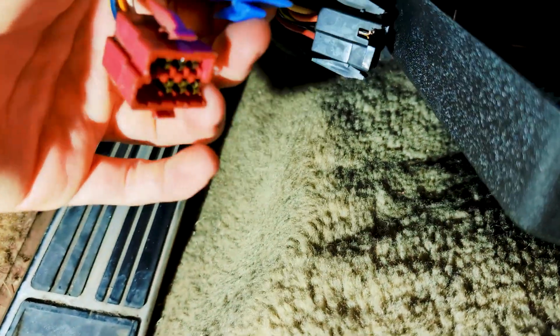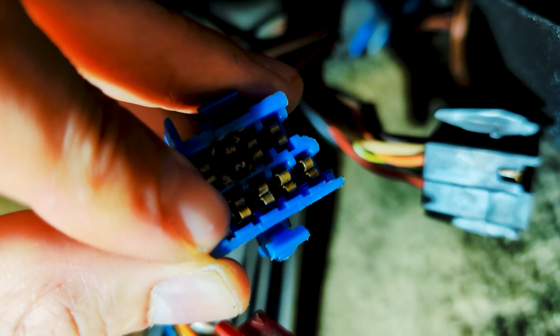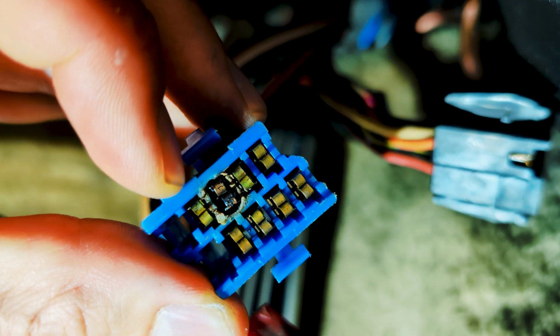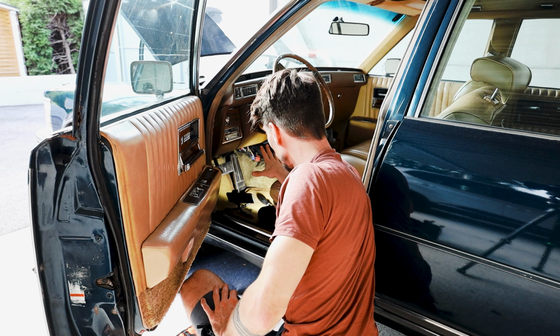One connector I think is this one, yeah. Here we have the bad wire end. This thing here, which looks pretty burned up, is for my fuel pump. I pulled all three connectors to the ECU, which means we can cross the ECU off the list of things that could cause my parasitic draw. So I connect it again, cross it off the list, and we see what's on the menu next.